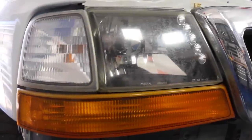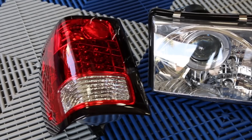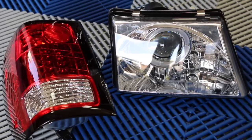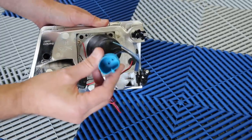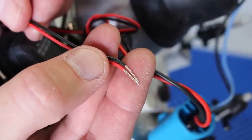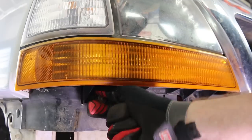Back up front was a big problem — the headlights were mismatched. One was an HID conversion, the other one wasn't. They just looked stupid. My friends at Spyder Auto came to my rescue with their LED taillights and projector headlights that feature an LED halo. Now they don't make the side marker lights, so I bought some online and went with the completely clear look. The front lights have a connector for the factory wiring harness and two wires that connect to your side marker lights to illuminate the LED halo. To remove the headlights, grab some needle-nose pliers and pull out the headlight clips — they can be a bit snug, so wiggle them loose or grab some lubricant.